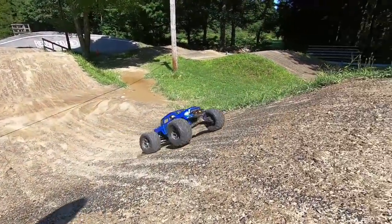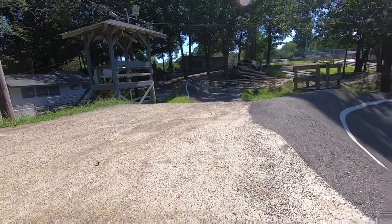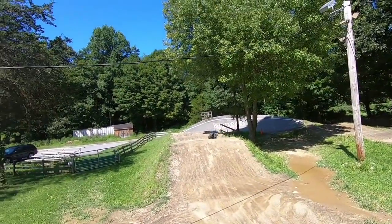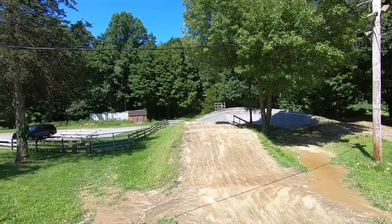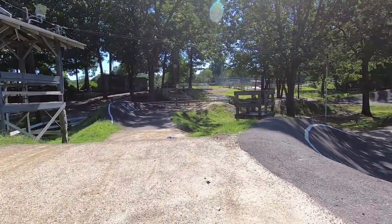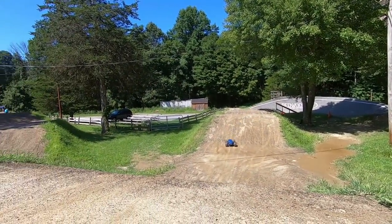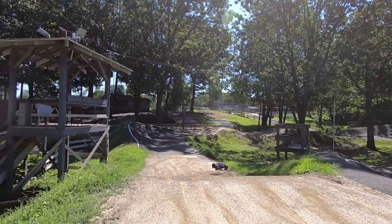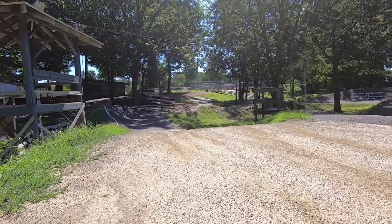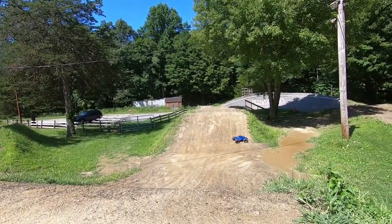And finally, what I want to talk to you about is, again, those tires that grow, all the power going up to the front. The differentials in here are grease filled. They don't have oil in them. So because of that, a lot of the power just goes to the front of the truck, and you'll see the wheels grow. Now, in my experience in the past with other vehicles, when you get a lot of power going to the front, it tends to heat up the differentials, whether it's the center or maybe the front, if the front wheels are growing from side to side. When that happens, that heats up the differentials, so there is the potential of a failure there. It is a plastic gear cup in there, and the cross pins from the spider gears may want to work their way through. So just be aware of that. Don't go crazy with nonstop speed runs back and forth, because all that power going to the front may heat up those differentials. Nothing happened here, but it is something to be aware of.